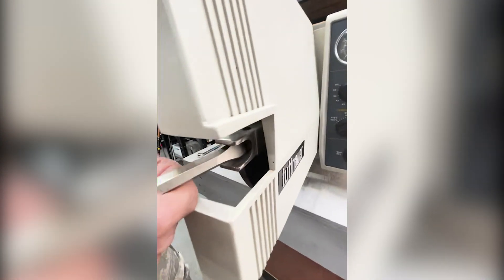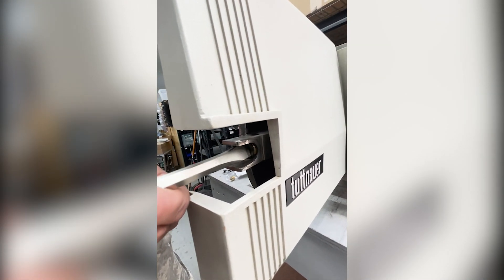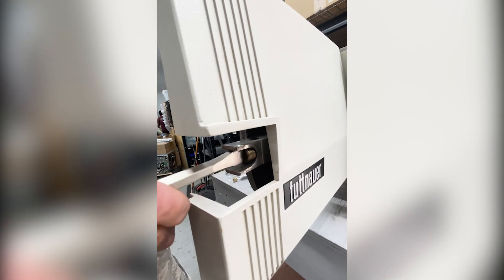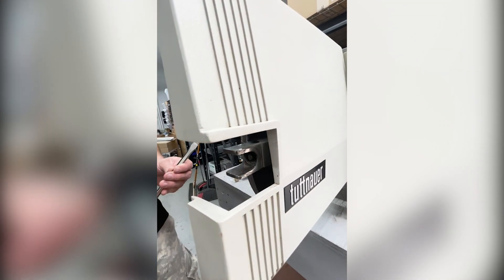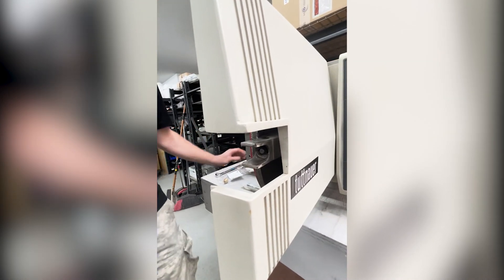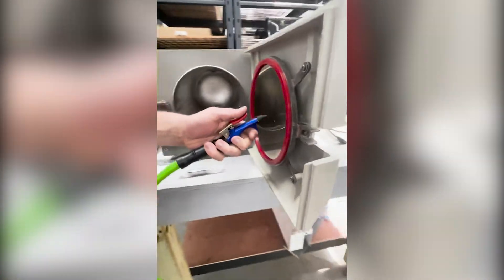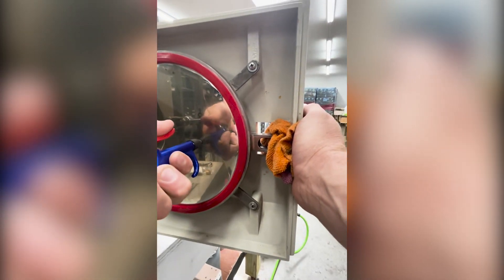To remove it, I'm going to use a big flat head. This one has already been loosened up — it usually does not come out that smooth — and the door bellows will pop out. Whenever you're changing your door bellows, you always want to change that bolt as well. To get the rest out, cover the end with some rags and you can use a compressor. I'm going to put a little bit of pressure right here and hold my hand right there.